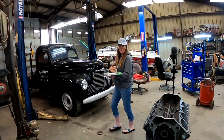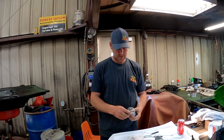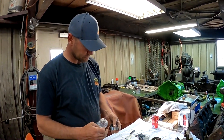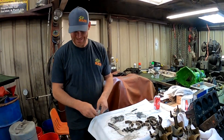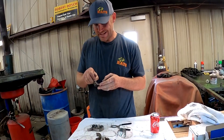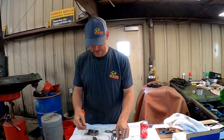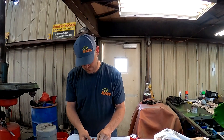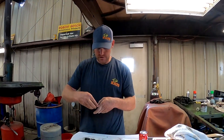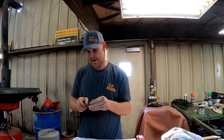I'm going to leave with these giant chocolate bunnies now. You know what that's from? I'm allergic to work — and this is about to turn into work right here, putting all this together. Now these bearings are standard and that crank is supposed to be standard from everything I can measure. So we'll put them together, plastic gauge a couple of them, and see if they're happy. If they're happy and they know it, we'll torque them down.